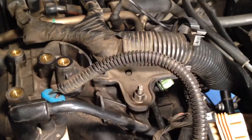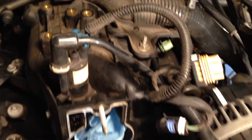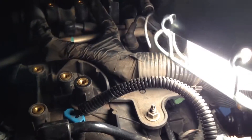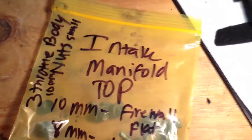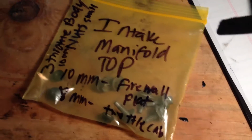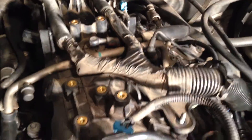We're going to try to start getting some of these wire harnesses out of the way. I'm going to start with that eight millimeter bolt right there — it's right behind where the throttle body was, holding that clamp down. Actually, correction: it was a 10 millimeter bolt. But removing it allows this whole thing — these two big wire zippers — to come off.